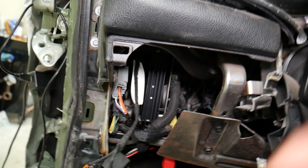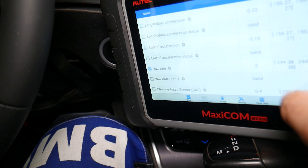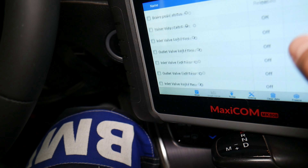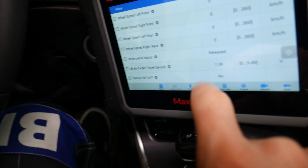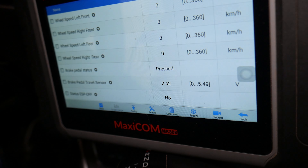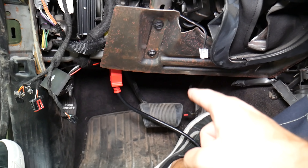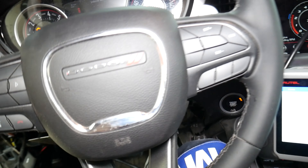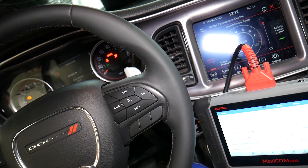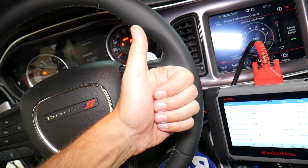Now you need to test your brake light switch, because the brake light switch is the one that deactivates the cruise control. It's right here on the top — it says 'released' now, and if I press it, it will say 'pressed.' Also, if you still have problems, you may need to actually calibrate the brake light switch, because if it's not calibrated the cruise control may not work. Those are the very common reasons. We'll have a video on the channel on how to calibrate the brake light switch. Thank you for watching, see you next time.